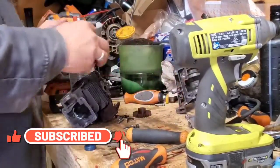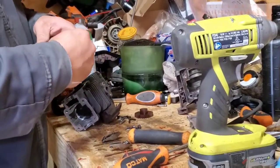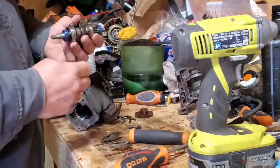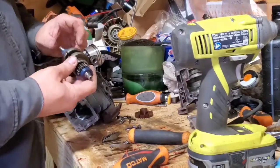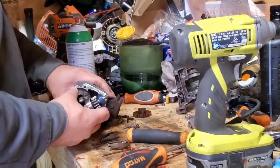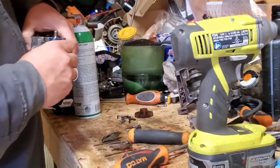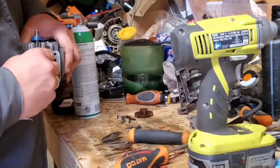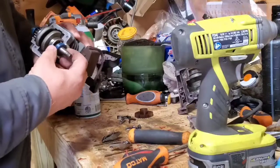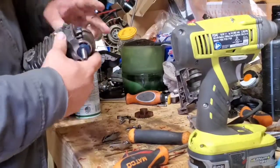The first thing I need to do is get these seals halfway on here — a little bit of RTV on here from when it was on. We'll make sure your rings are oriented correctly, then you're going to stick this sucker in here. It is beveled, it will allow it to fall right on in — just push that sucker in there. Make sure your seals are lined up before final assembly. I will be putting sealer all over this.